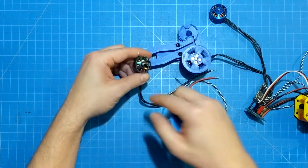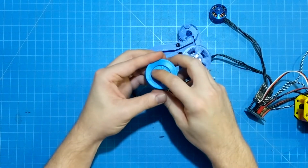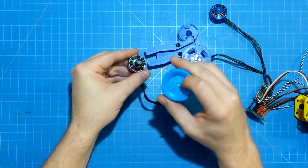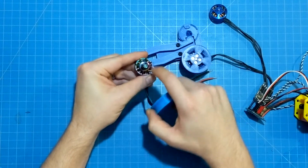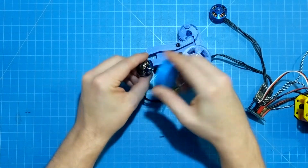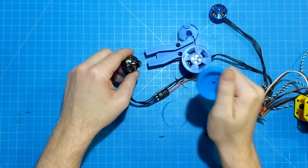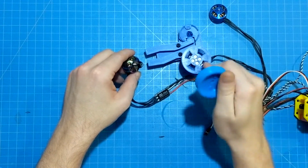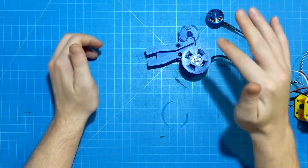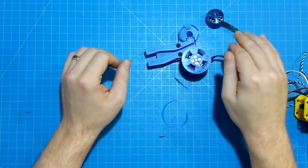So when you have a flywheel, just again for reference, on these old ones, you can see on this flywheel there are these 2 tabs, and then there are these slits on the side of the motor. Those tabs are meant to lock down into the openings on the motor, and that's what held it in place. Even if the nut came slightly loose, it wouldn't slip around, and it would hold it down. On these, you don't have that, which is actually a really nice thing when it comes to designing the flywheels. Instead, you just have the 4 screws. Because the Crux wheels are the ones we are using now, and this is my preferred format, I'm going to go over how to do flywheel balancing and mounting with those in particular.